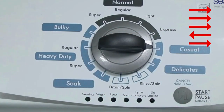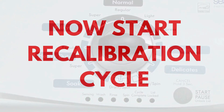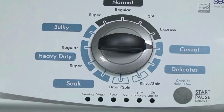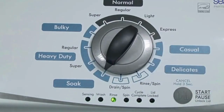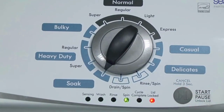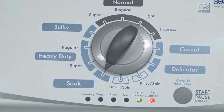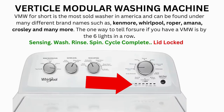All the green status lights blink when you successfully activate the diagnostic mode. If the status lights don't blink, try again, this time turning the knob faster or slower. In the diagnostic mode with all lights flashing, select the calibration cycle by turning the control dial 4 clicks clockwise. When you're on the correct setting, the rinse light turns on — then simply press start. It begins the calibration cycle, which runs for 2-3 minutes as it checks all the cycles and functions on your machine. When the calibration cycle ends, if all goes well, the lid unlocks and the washer shuts off. Now try your washer to see if that's solved your issues; if not, continue to the error code video.